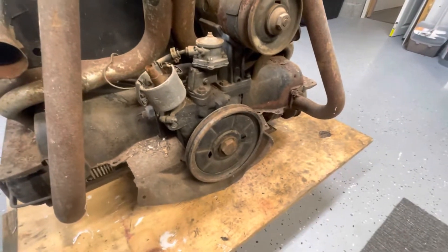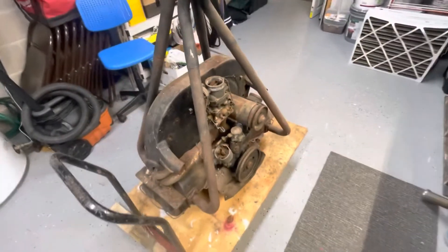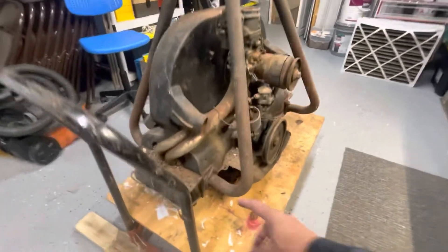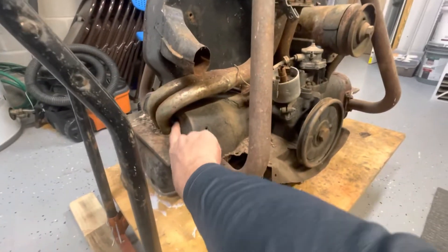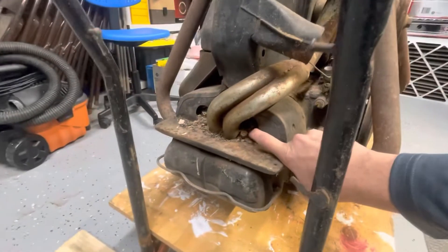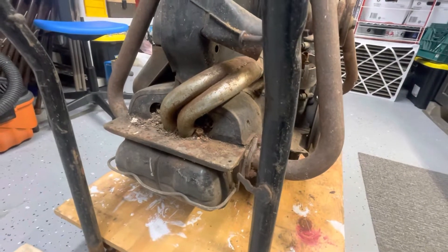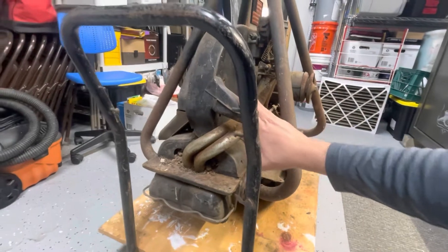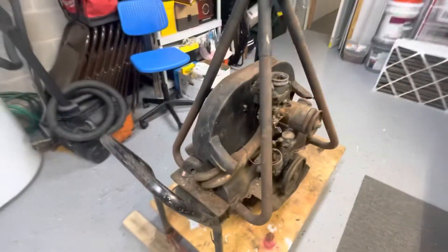She's probably stuck. I'm gonna guess that's probably just the rings that are rusted or stuck in place. So what we'll do is get these areas cleaned up right in here where the spark plugs are, right down in the holes. We'll probably pull these tins so I can clean underneath them. That means we'll take the doghouse off, take some other stuff off, and get some areas cleaned up - get ready to rock and roll on this thing and see what we can do.